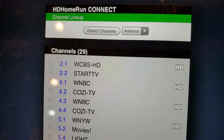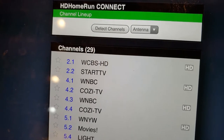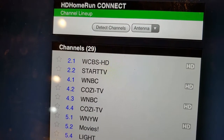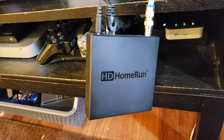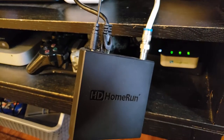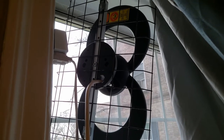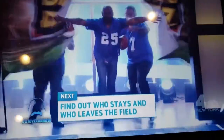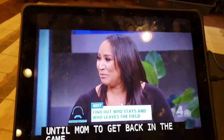I think I'm going to leave it like that. The other one had 31 channels, probably channels that I'm going to need, so those other two channels matter. I'm going to keep it like that so there's only one antenna for both devices — the TV and the HD HomeRun. This is the HD HomeRun: I have the coax, the ethernet goes to my network, power, and the coax going to the antenna. And this is where the antenna is, on the window. It seems okay, and as you can see all the channels are coming in clear on my iPad.